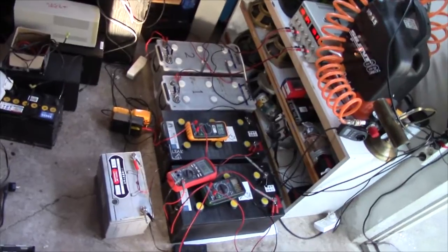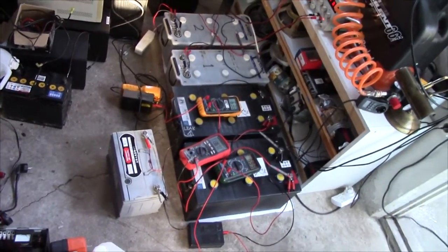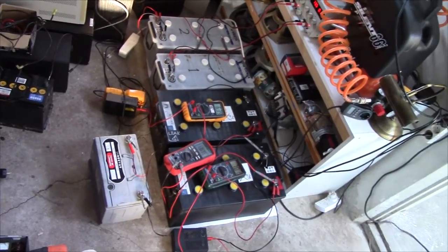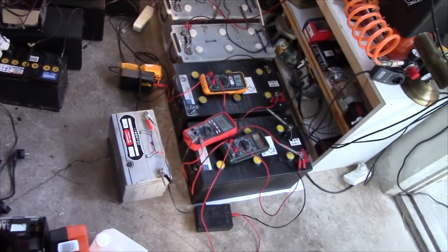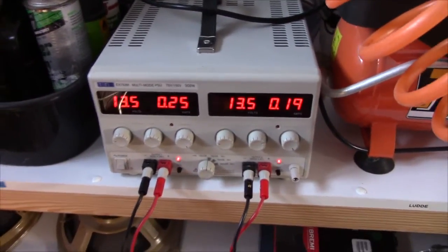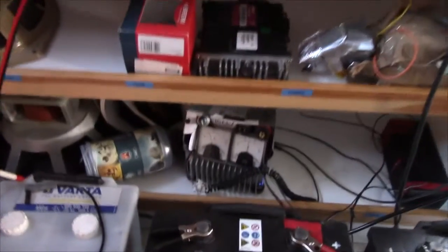And there we go, everything's set up to charge overnight. I was afraid I was gonna run out of clamps, but I've got every single battery clamp I own, save for all my jumper cables, in use here. Floating two batteries and charging three all at once. We've got one charger there, charging that one, another one there, charging that one, two chargers there, well, lab power supply, floating those two. Okay, this one was floating at maybe 0.35 earlier today. Glad to see it dropped. And finally we have my old lab PSU giving the final topping to this guy.